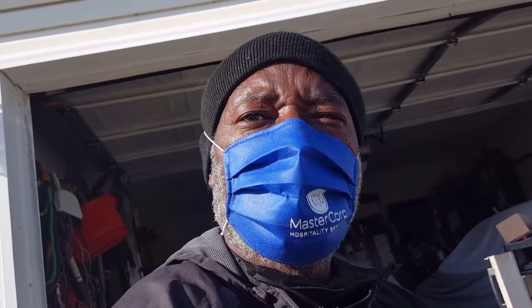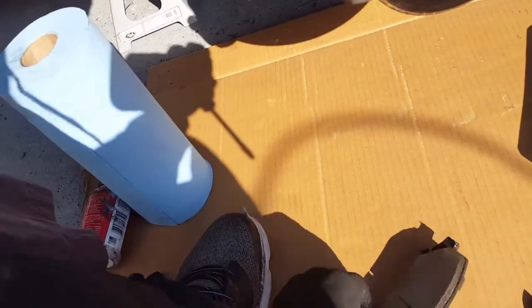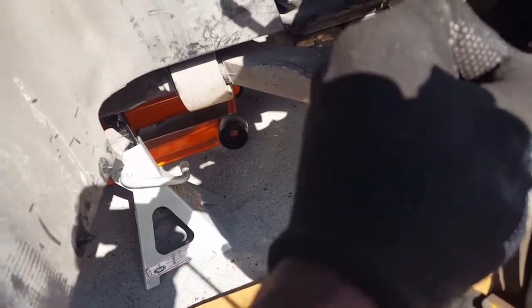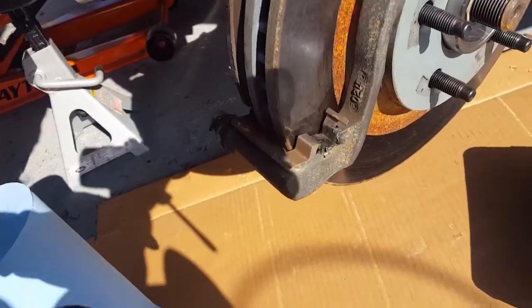That's why he brought it to me — he wanted me to check it out. Spent all that money. That's what you've got to know, it's what you've got to look for. There's no wear and tear on the brake pads; the brake pads are in good shape. The brakes slide in and out of the pin pretty easily, so the squealing wouldn't be coming from there.